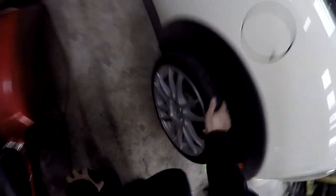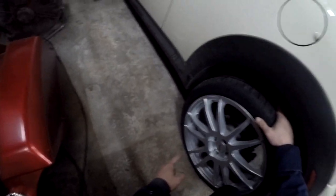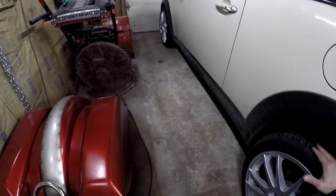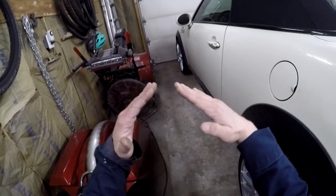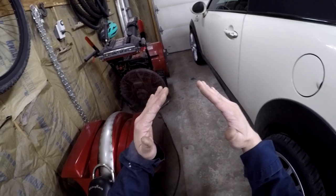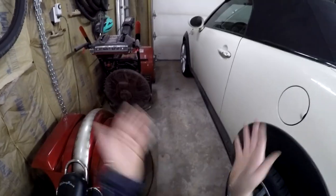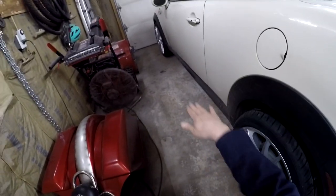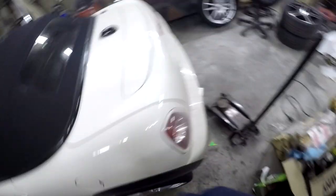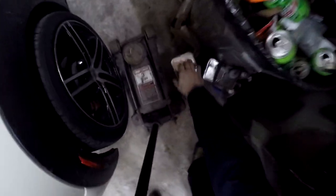You can see right now this gap is larger than it was before, but they're the same size wheel and tire. That's because the e-brake is set — once I drop that e-brake it's going to drop down to its normal ride height. Also, the front suspension geometry means the track width gets narrower when you lift it up. So now the tires hit the ground and keep it from going lower. Take the e-brake off, drive back and forth and it'll settle back down to its normal height. I still have the other side to do.